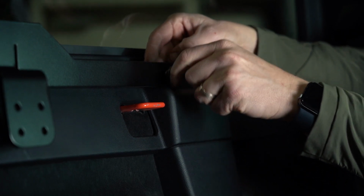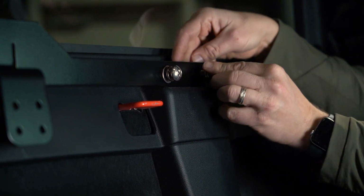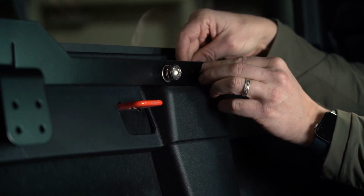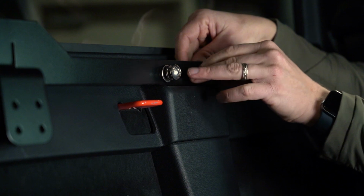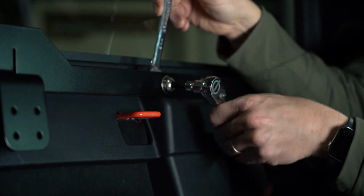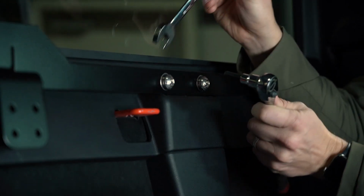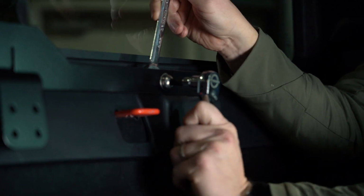If you are having trouble aligning the two support plates, these two bolts may be installed first to assist with installation. Note how the washers are stacked. The flat washer is to be installed so that it is against the bracket, and the lock washer is next to the head of the bolt. Install using an 18mm wrench and a 10mm Allen key.